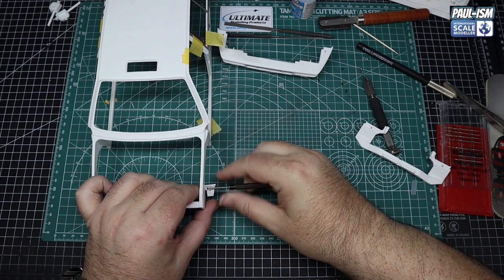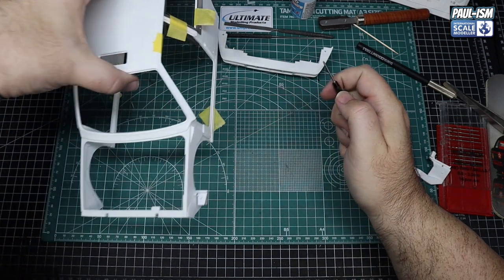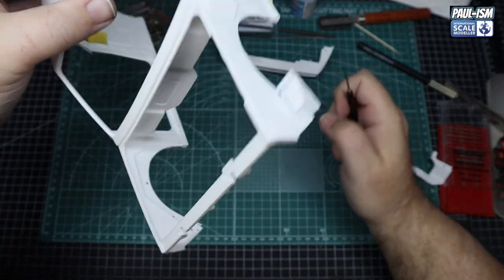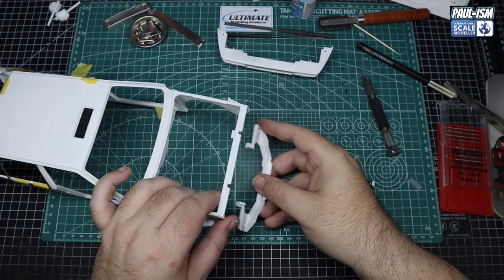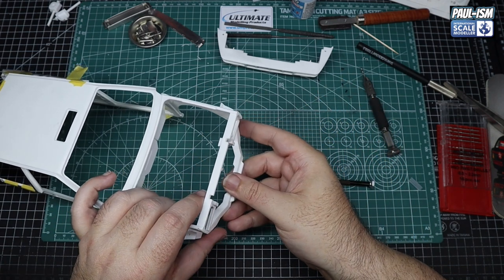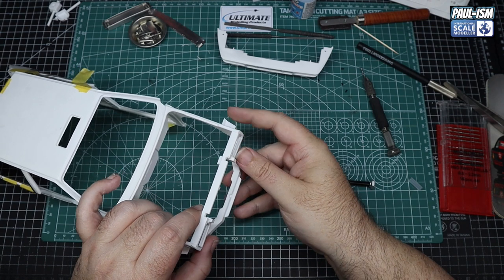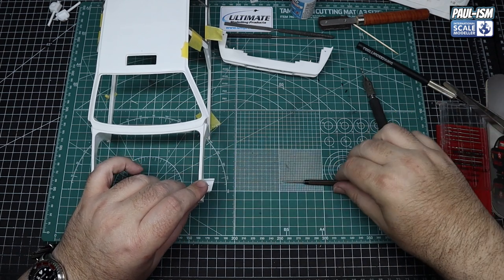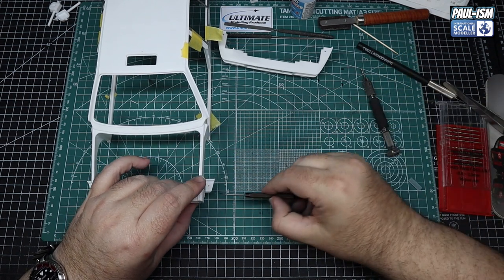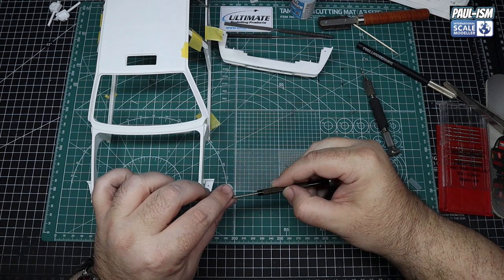These are supports to hold the bumpers in place. A little bit tricky, a little bit fiddly, so be very careful here. Don't put them on too tight to begin with because you will have to move them around. There's them both in place. The front, for instance, I've had all the holes drilled in, and in the side of the body as well. So it's a case of just lining that up at the front, and then screwing it in place as and where required.